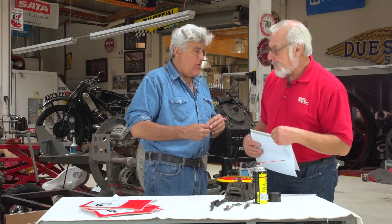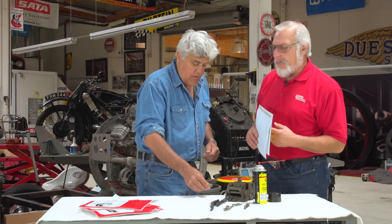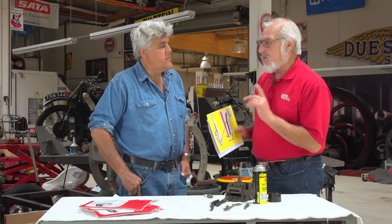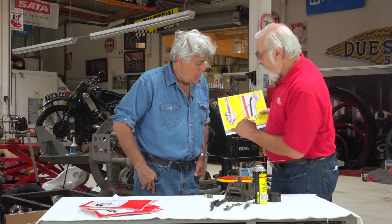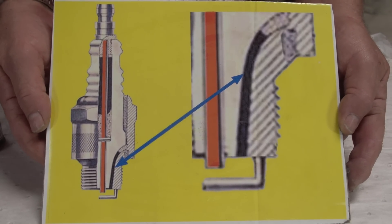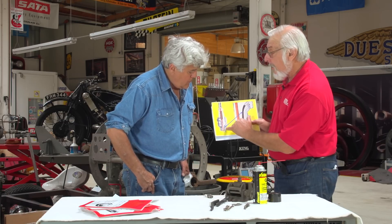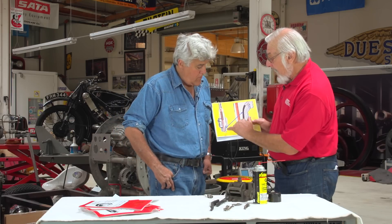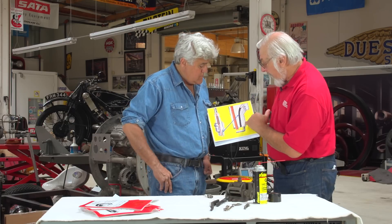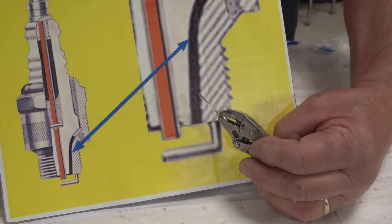I've been guilty of that. What we used to do is use brake cleaner and just soak it. Brake cleaner, carburetor cleaner — anything like that. I don't recommend that plugs be media blasted for two reasons. Number one is the glaze on the insulator. The center electrode goes down and it's protected by a ceramic insulator, which sits inside the outer metal shell — part of the ground electrical system. But there's a little gap between the ceramic and the metal shell, and you have to make sure you get all the dirt and grease out of there. I use a very, very sophisticated tool for that.